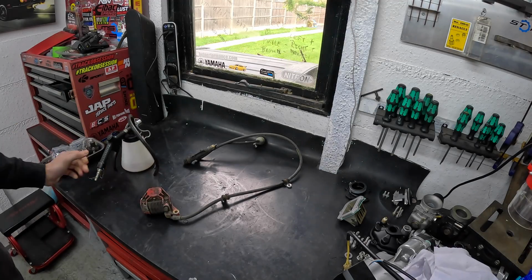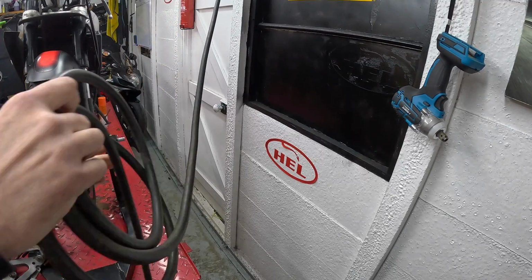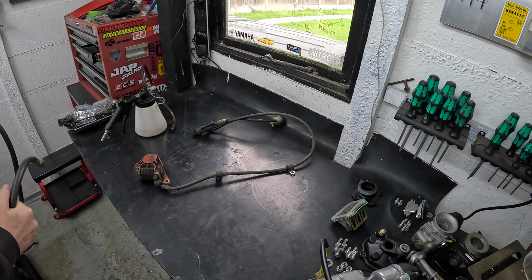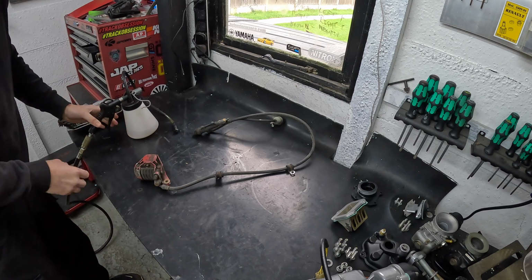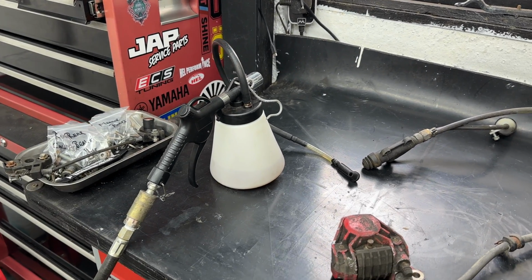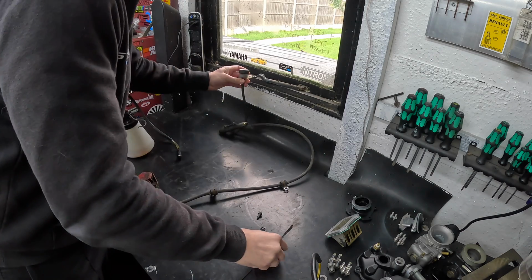With the rear brake assembly completely removed from the bike, it made sense to drain the fluid. Even if I wasn't going to use the parts from this, I didn't really need anything leaking out into a box. And for those of you that don't know, brake fluid is pretty corrosive, so I don't want it stripping any paintwork off of anything left in storage. So with the vacuum bleeder in place, I could then undo the bleed nipple, pull that fluid out, which I think you'll agree was well past it, and certainly satisfying to see it come out of the system.